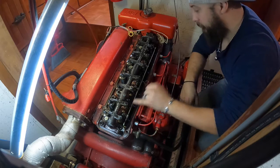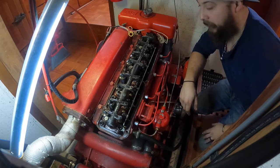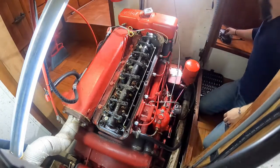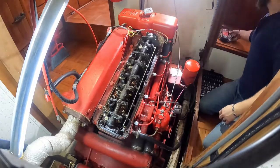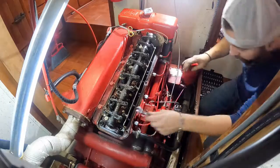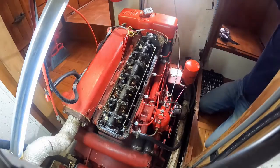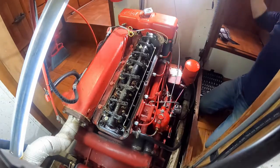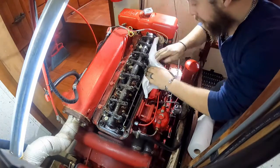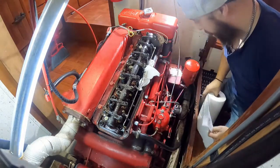The injectors are sitting in here, so we're going to take the lines off, take the injectors out, and the overflow tube — the return line that goes back — we're going to knock those off and get these injectors out. I'm gonna shove some paper towels in the openings here. Everything on the top of a head is usually pretty sealed besides where the push rods go through, and if I can drop something through a crack I will, so we'll just chuck these in here just in case something goes astray.